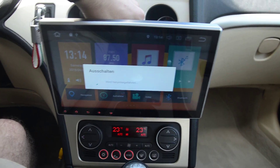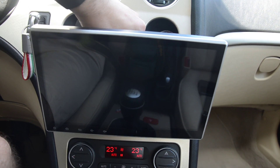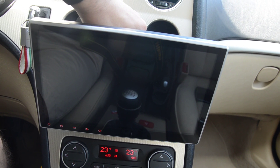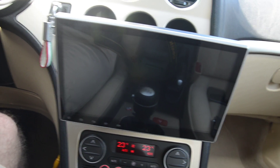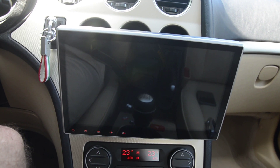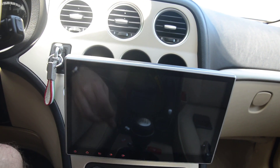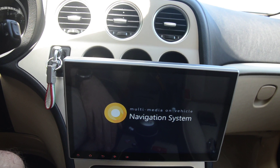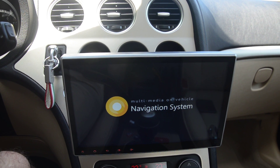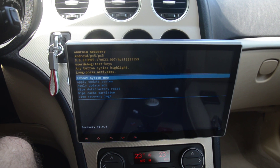You're going to be holding it. After a while, you'll see the buttons on the bottom left blink. They're blinking. After they stop blinking, you release the button and it should boot into recovery mode. Let's wait — it should boot into recovery mode. You can see the logo here, and boom, back in recovery mode.